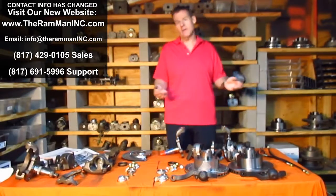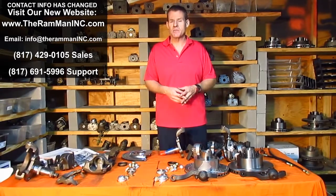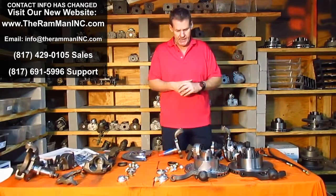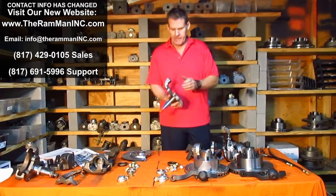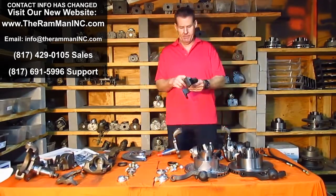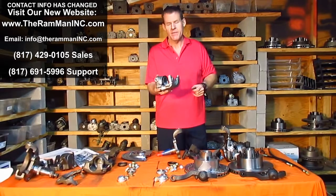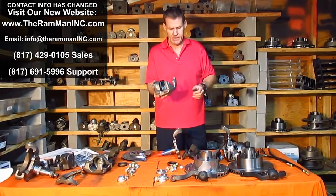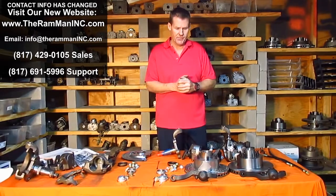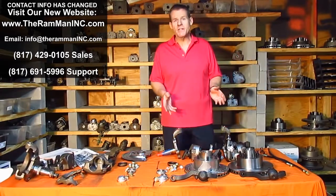If you're going to the wrecking yard, you don't have that option. So basically what we did was we reproduced those components from the forged spindles out. Those '76 A-body components really are a bit of a mix and match. These spindles are actually borrowed from '73 and '74 E-bodies. They made a different caliper bracket, and the sliding calipers were introduced in 1973. They're a very effective and cheaper system, and they work well. Mopar revamped all of their braking systems in 1973 just to keep up with the market. So basically, that's all that you have to do.